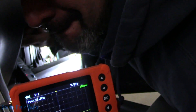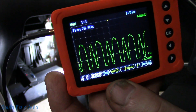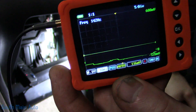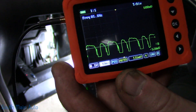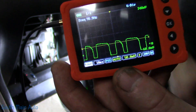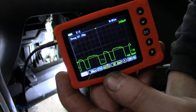Let me whack the button. Of course, we've got to put it on number four — high speed goes through a different wire. That's funny. I've been turning this thing on and off a lot and it starts every single time. But let's say this one wasn't as bad as it is, because clearly this is really bad. If it wasn't, we would still easily be able to see this using an amp clamp and the U-scope here — we can see this thing has humongous opens in it.